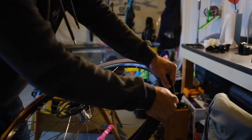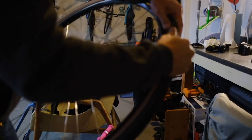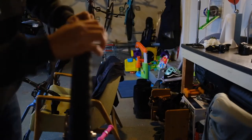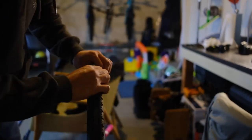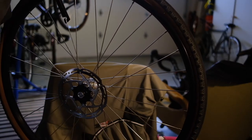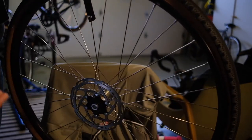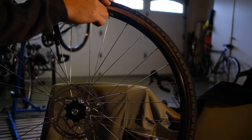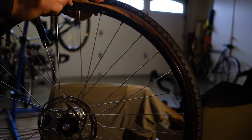What I'm doing now is getting these tires off — these are really on the bead. You want to get the tire completely off the bead before you start putting in your tire levers, because it'll make your life a lot easier. The bead is really tight on this rim, which is actually a great thing. I have one tire lever set up to hold the tire out — just be patient, because this stuff is never easy.